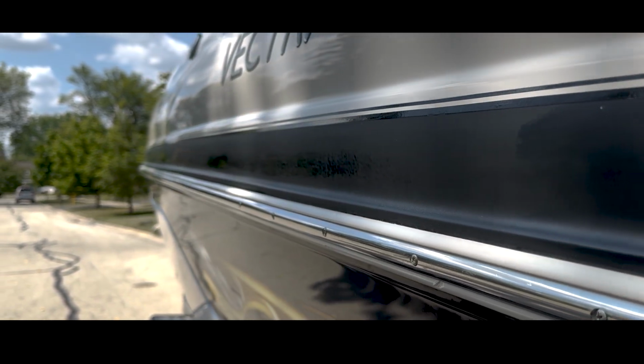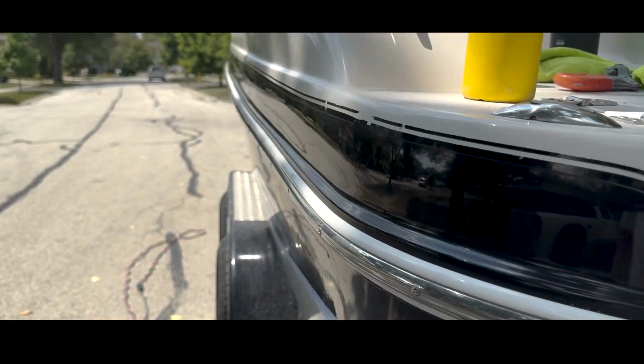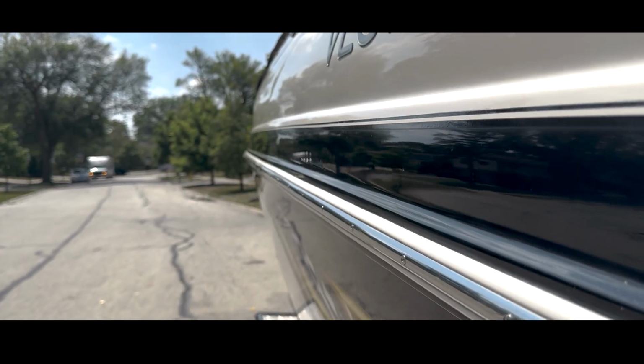Moving on to the black just above the rub rail, and I'm going to run the exact same process, starting with 2000 grit and some fresh wool pads. After our 2 passes of heavy cut, everything is finally tied together above the rub rail. Dark colors will chunk up your pads, so be sure to spur and brush your pads often.